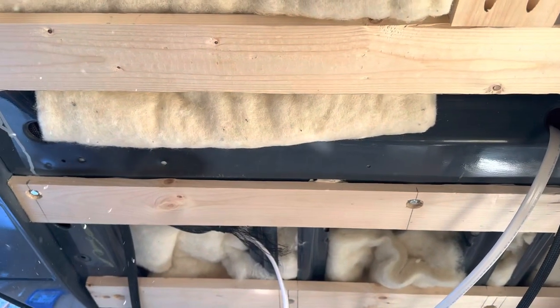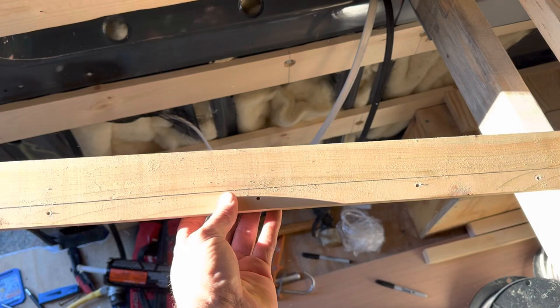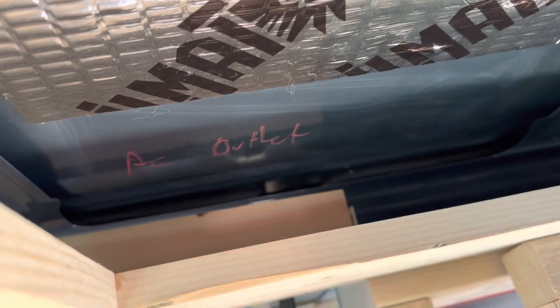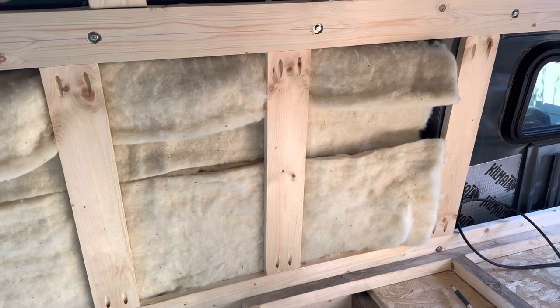If you put the insulation in, it wants to come out on the underneath side. So what we've done is I took a piece of 1 inch by 2.5 inch stock, and we're gonna create a little shelf just like that so that it keeps the insulation from falling down. All right, quick, easy fix, and that way that won't fall down through that. And once the wall board's up, it'll hold all that in place.